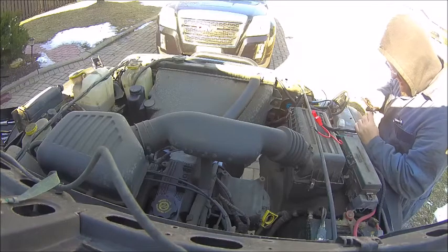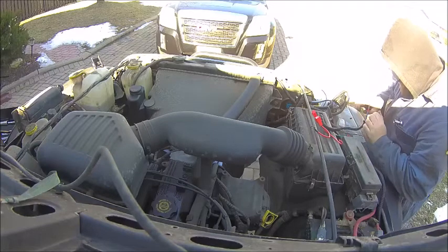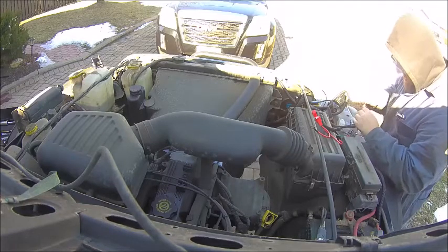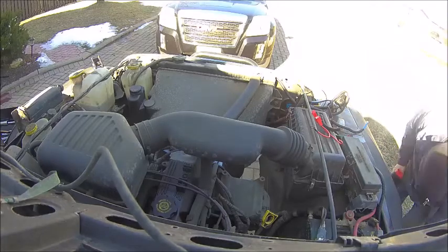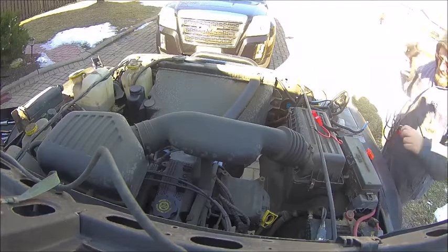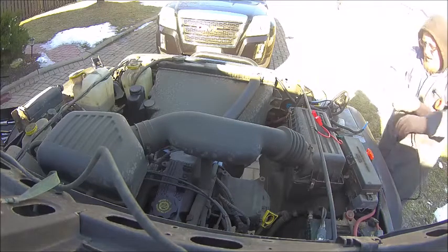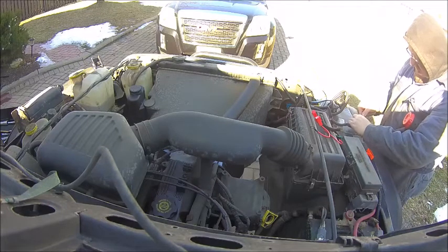It is in a pretty safe spot in the Jeep. That's obviously where my air intake is, so that's the side that I keep out of the water. I keep it dry and clean as best I can, so it's not a terrible spot, but anything I can do to make sure that it's sealed up is the right way to go. I have dealt with, in my previous Jeep, a lot of very scuzzy wire, and it's my commitment on this one to make sure that I do all the wiring as best I possibly can using solder when possible, and if not, if I'm using crimp connections, to make sure that they're heat shrinked and not just electrical taped out of the way.